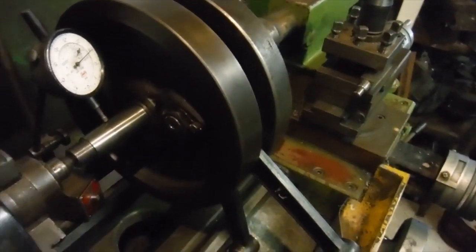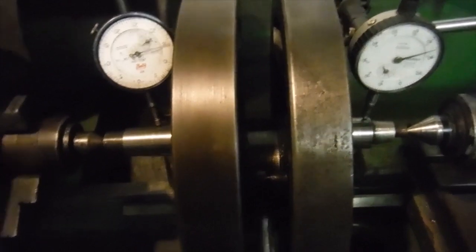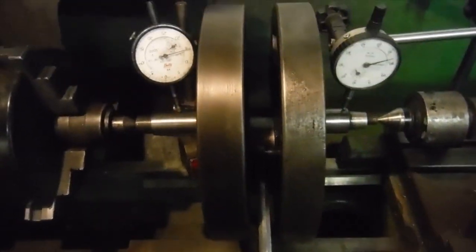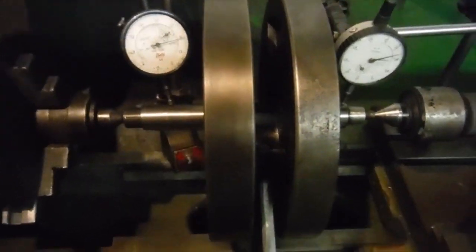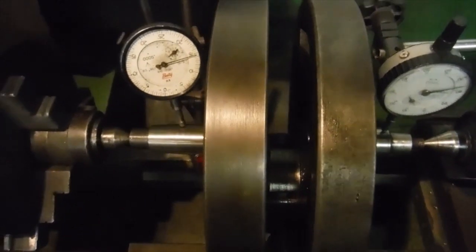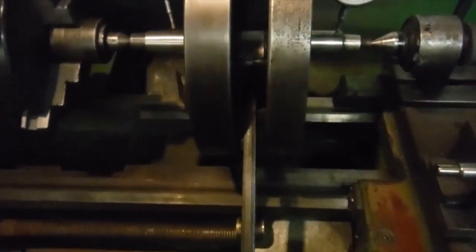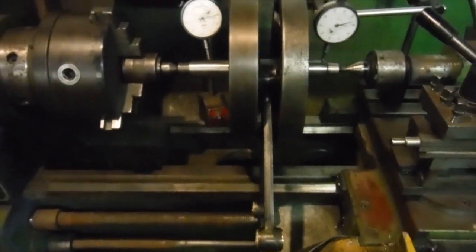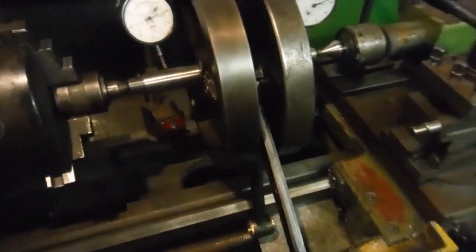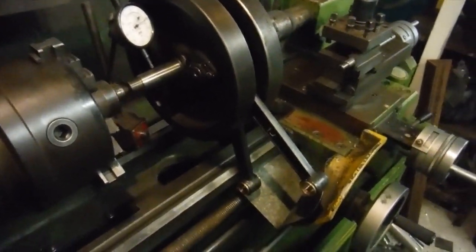I've got a new crank pin in it, I've got new big end rollers in it, and I've even fitted new outer races for the big ends into the conrods and honed them out myself until they were a good fit with the smallest of three sizes of rollers you can get for these. So there's room for it to wear, so perhaps in the next 100 years or so it might need rebuilding again with the next size up, but it should see my generation out, all being well.